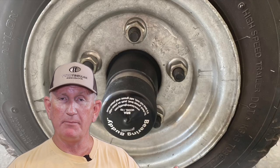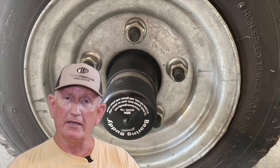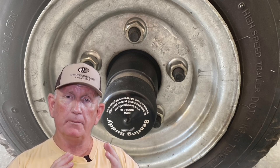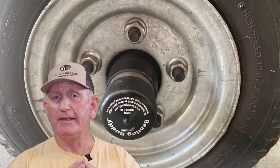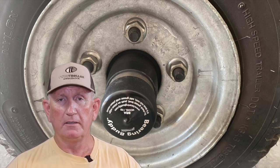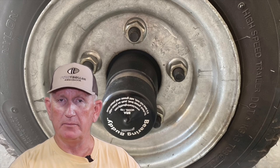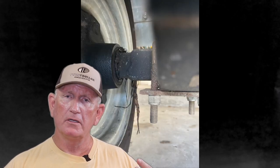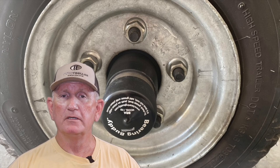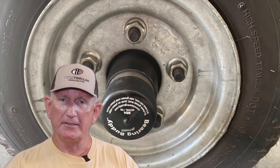In the same area as the tires, you have your axle, and the axle has a hub on each end. In the hub there are two bearings, one at each end of the hub. Those bearings and the whole axle get backed into the water — especially salt water, which is much more corrosive — but you still need to maintain those bearings.